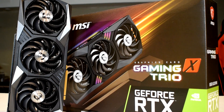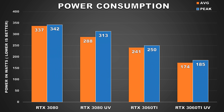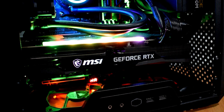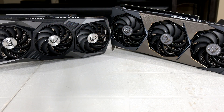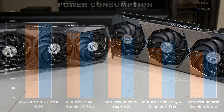Previously, when we undervolted the RTX 3060 Ti, 3080, and 3090, we saw that undervolting provided significantly lower power under load, lower noise, lower temps, and while we did see a decrease in performance, it wasn't substantial — in most cases the user wouldn't have even noticed. One thing that everyone knows for certain is that when it comes to Ampere, the cards aren't particularly wowing anyone in the efficiency department. The 3070 Ti especially didn't impress me since it was considerably closer to the much faster RTX 3080 in power draw. However, with how much headroom we've seen from other GPUs, I believe we can fix that.